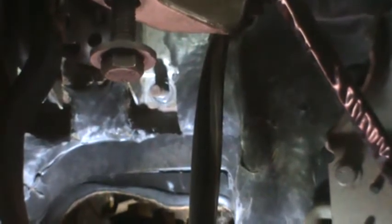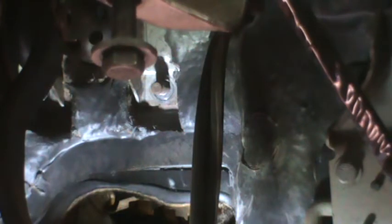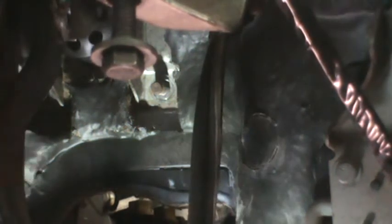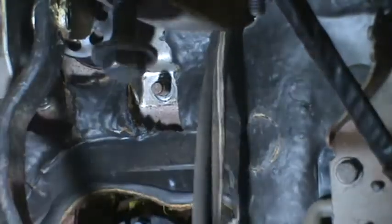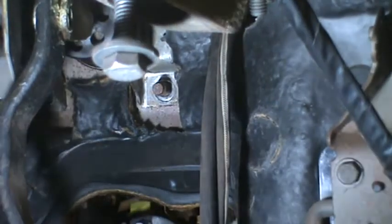So I've got myself a swivel here with some black electrical tape on it that prevents the weight of the socket from causing it to just flop over. So I'm gonna put that between my long extension and my socket. Let's see if I can get it up there on the nut. And even with that tape, it is a little bit wobbly.